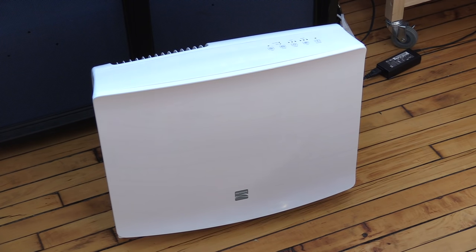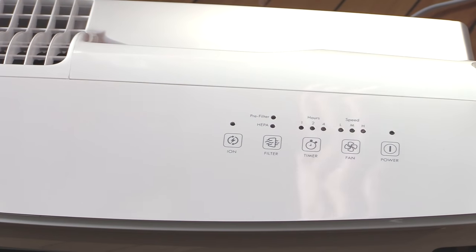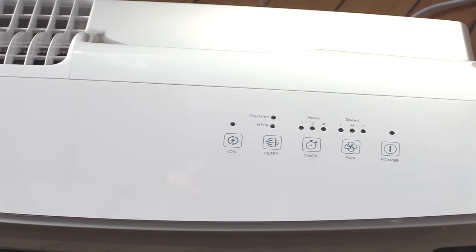This is just a cheapo machine. It doesn't have the sort of filtration in place to really do ionization safely and take the ozone out. It's just dirty. So even before I turn this on, I'm going to go in there and disconnect the ion feature right out of the box. This unit comes built in with a high voltage ionizer — it's basically just a big ozone generator. My plan is to make sure that it will never turn on.